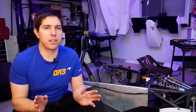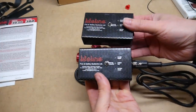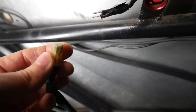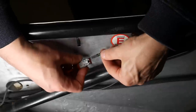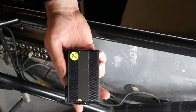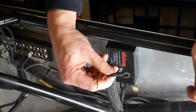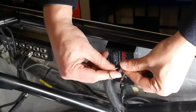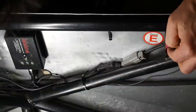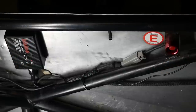Hope you're still with me because we're on the home stretch. Only one part left, and that's the wiring between the power pack, extinguisher, and switch. The new and old electronics are likely identical, but I still thought it best to install the new one to address some very questionable wiring on the previous install. To avoid dodgy spade connectors and ensure everything was waterproof, I went with a 2-pin Deutsch connector and kept things tidy with plenty of heat shrink. I installed the new control box in exactly the same spot. The wiring circuit is really straightforward — one cable to the tank, one cable to the box, bridge the two blue wires, and the two brown wires go to the switch. With everything plugged in and insulated, we can finally test the new system. With the control box switch in neutral, testing the trigger button rightly illuminates the test LED, and before going on track I would switch it to armed.